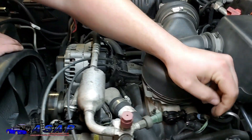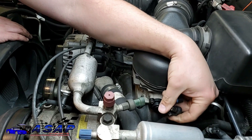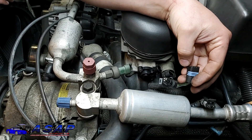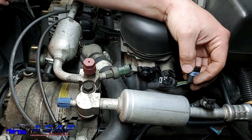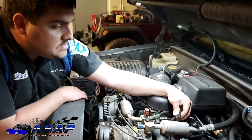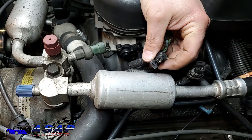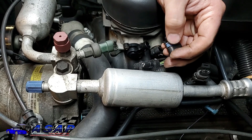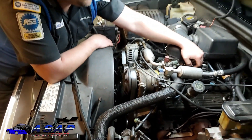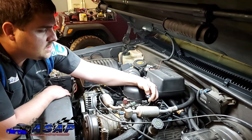All right guys, we got our screws in there and snugged down — remember, don't over-tighten them. Next thing, plug stuff back up. Now, keen eye will notice I've got two problems. One being that this little seal around here for this Delphi connector is rolled over. Somebody unplugged it and didn't pay attention when they plugged it back in and rolled it up. That's not going to seal properly and it's going to allow water to get in there. And on my throttle position sensor, I've got no seal at all — there's supposed to be a rubber seal around there. Looks like I'm going to be making a trip to the salvage yard to pick up a couple of these seals.